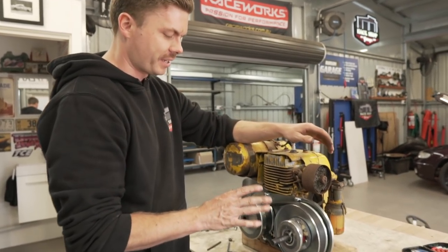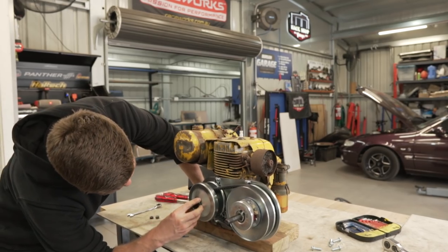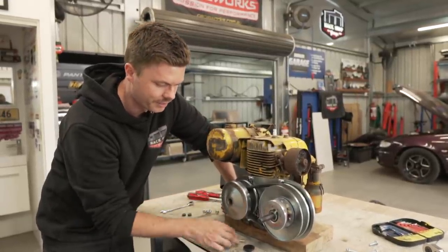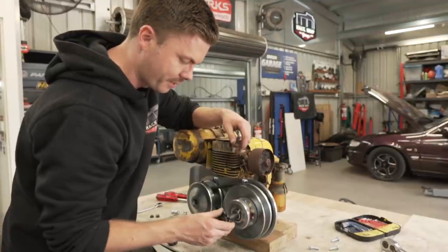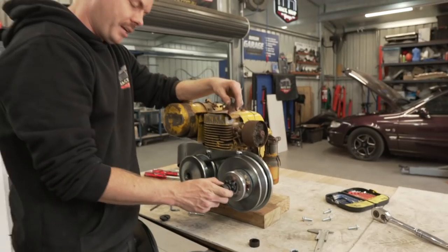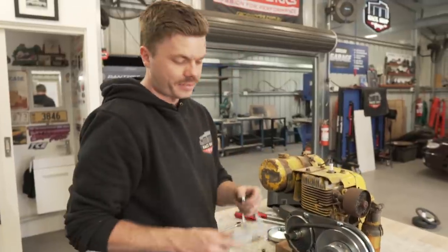So we've been looking at this wrong for the past 30 minutes, and then we're finally turning around and we think we have this sorted out, the way this clutch works. We think this is how it's supposed to work. One thing we have to do is this little end cap goes in here, and then we assumed, there's no instruction with this by the way, that is like our crank bolt, I suppose. So we're going to have to tap and drill that out to be able to put that in there. And then this, we think, goes something like this, and then that sits on there with your bolt. So what we're thinking we're going to do is zip all this up, see if we can get it to run and see if the clutch works. All right, no time like the present. Let's get into it, eh? All right.